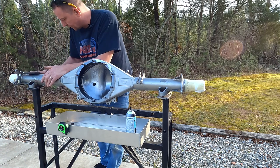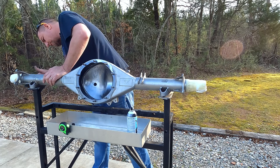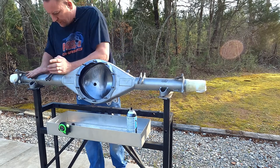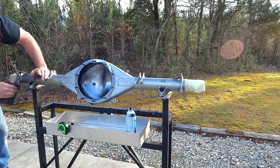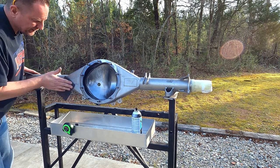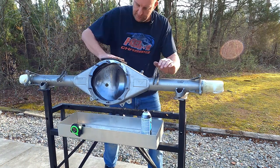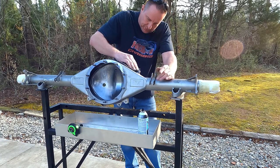Basically, what I'm doing is using a heavy grit Scotch-Brite to knock off all of the surface crud, a little bit of surface rust that's on there, a little bit of oxidation, and given the coating and paint that's on here, giving it some tooth by roughing it up so that the paint that I'm going to put on it sticks. I also used a 3M Scotch-Brite wheel on a 4-inch DeWalt cordless to take down any of the heavy spots, but I think this will do it.